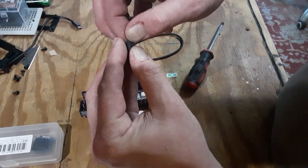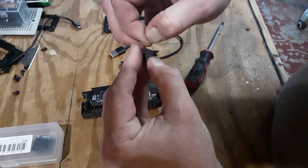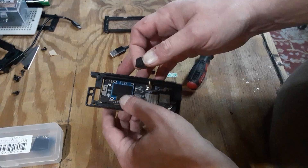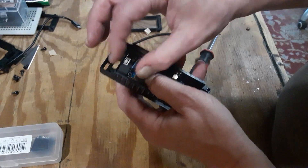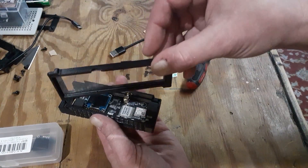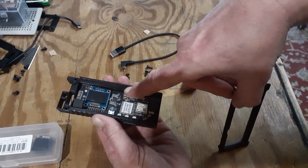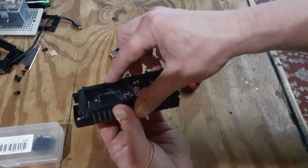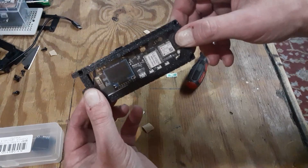Take another one and peel the backing off — sometimes it's a little hard to get off. Make sure that T-beam is seated, then put the other one down in that corner right there. On this lens there's a rounded spot that is made to go around the antenna port, so just slip this lens down right on top of everything. You'll feel that it's held off a little bit — that's from those hold-down pads.